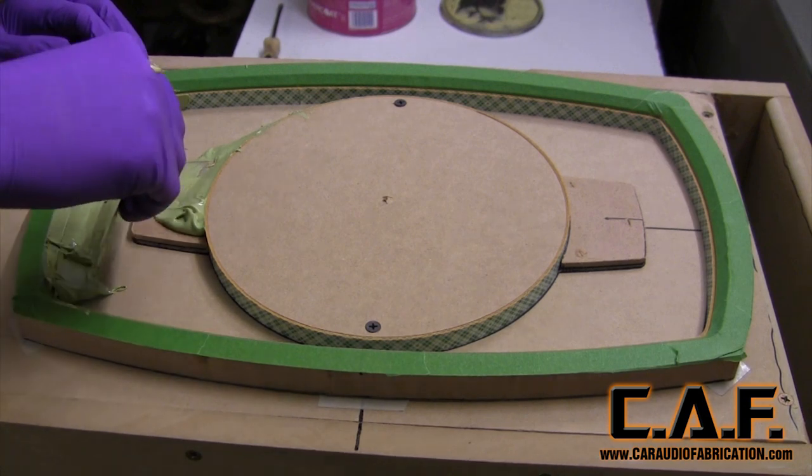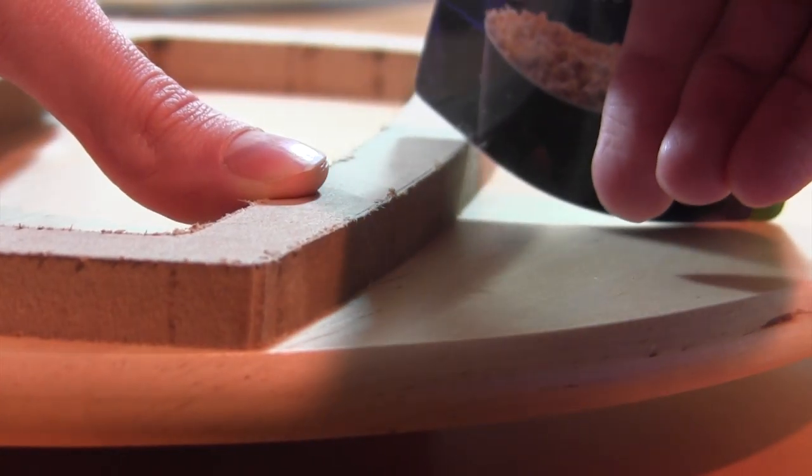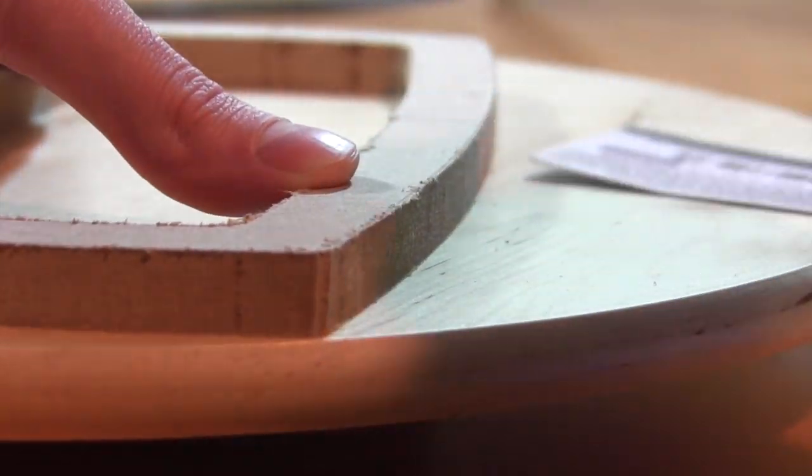The precision of that contour was based purely upon how steady your hand was. This oftentimes would lead to waves in the contour, which would mean you'd have to apply another layer of body filler and then sand it again. That's time and that's money. On top of that, the only way to add any curvature to that contour is to bend your spreader card, which is difficult to do and inconsistent.